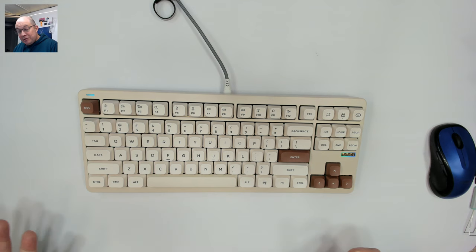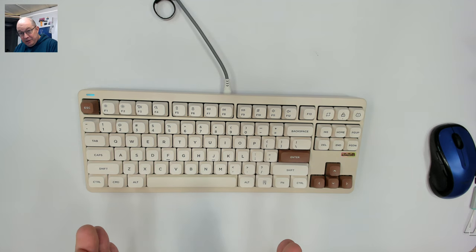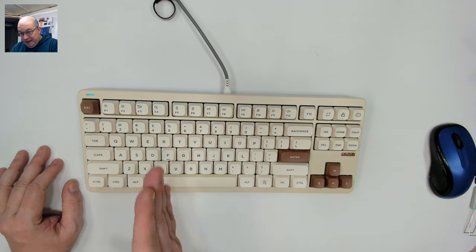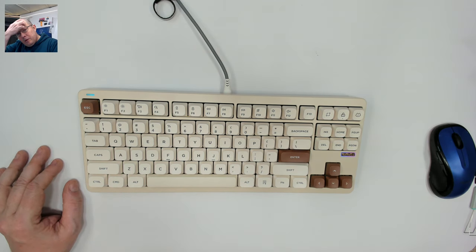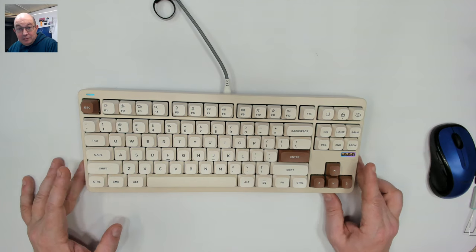You literally just get some side clippers, clip it at the base of the stem, move it over, and line it up using a standard key caps lock so that you can put the keys right next to each other, and line it up to the same position. Obviously you want to make sure it's right horizontally, but that it's in the same position vertically with the post. It's going to be basically in the center of the keycap in order for it to work, and then use super glue and baking soda to attach it. Leave it alone for a few hours. Doesn't take long. And then make sure that the stem doesn't move, and you've got yourself a step caps lock.